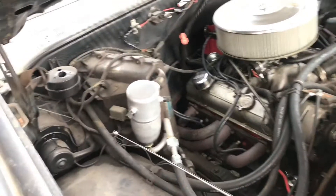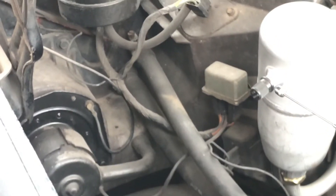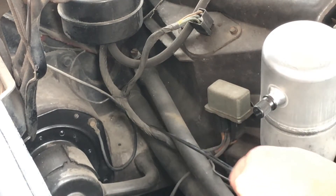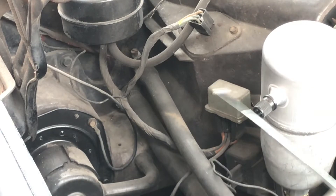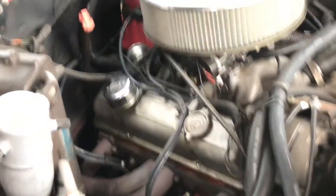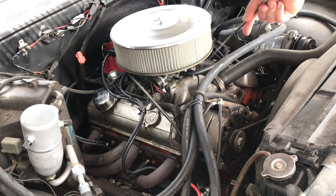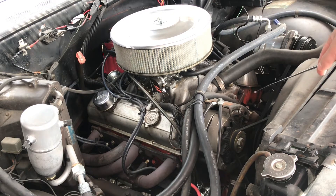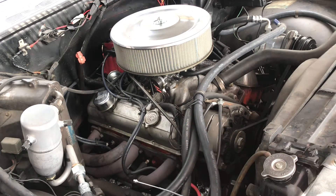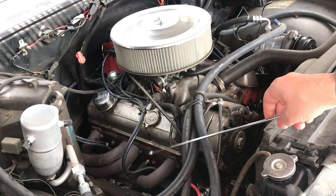It took me a minute looking at it. Every heater core picture I looked at looked different — well, my hoses are stretched. The 5/8" is on the bottom but they're stretched and swapped. So I've got to swap those two nipples, swap those two hoses, probably cut them back because they're stretched, and then put in my ball valve somewhere neat.